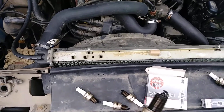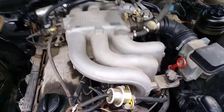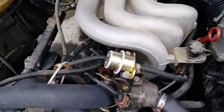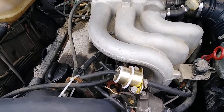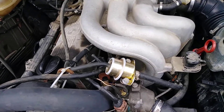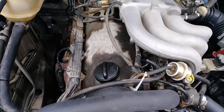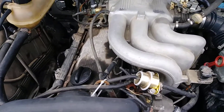I don't know if that is carbon or oil. The oil is black as the ace. I did replace the fuel pressure regulator last year, if you remember that video, because I thought it was dumping fuel into the oil — the oil smelled like fuel. So it's possible that I fouled the plugs out that badly and they're just shot. Plus they're wrong anyway. Or we have a problem with oil intruding into the combustion chamber while it's running. Don't know. It's one of those two things. We'll know when we put the spark plugs in and it fires up.